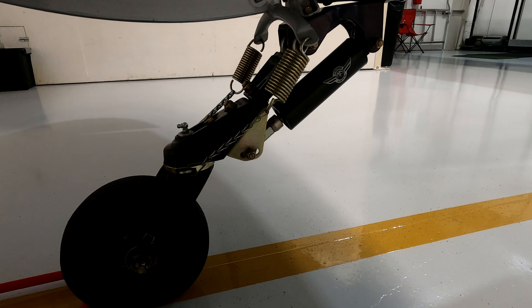I can expand the engine instruments — now you can see my four-probe EGT and CHT indications, belly pod fuel quantity, engine fuel flow, and engine fuel pressure. I've also got an iShield carbon monoxide detector; right now, since the engine's not running, it's zero parts per million. It sets off a master warning or caution on the PFD if that exceeds about 10 parts per million. This airplane has a dual electronic ignition system — no magnetos — with a dedicated backup battery for that ignition system in case the alternator or main battery fails. It has an EarthX ETX 680C lithium iron battery, saving almost 15 pounds compared to a normal lead-acid battery. The GDU 465 display also has a backup battery, so it'll keep working if the electrical system fails.